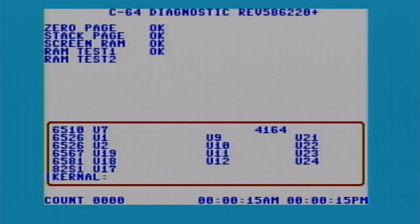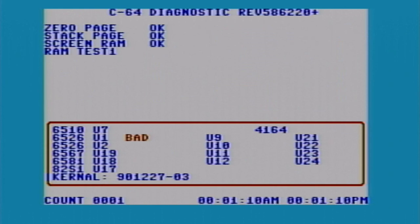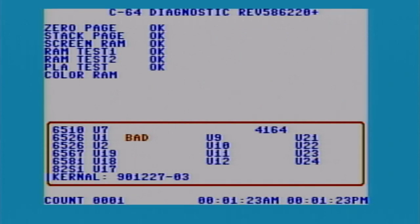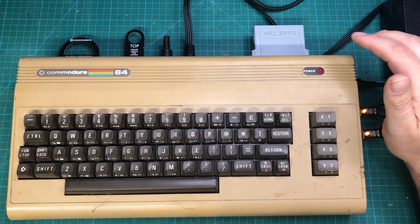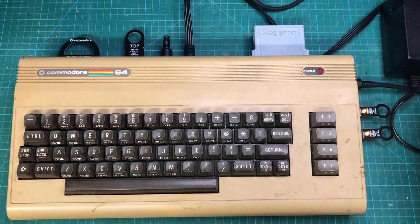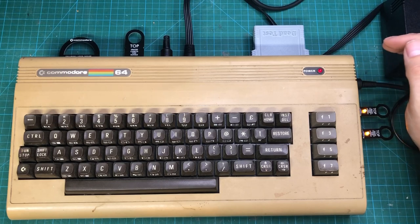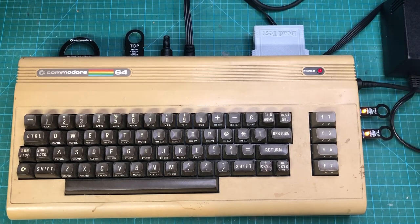This is very interesting — what it's telling me is that the control port is bad and the 6526 chip in U1 is bad. That is the control chip for the controller port, so that chip is probably bad, which is causing the port to report bad. Those chips aren't cheap — they run about $30 to $35 a piece. I had no idea; I bought this thing and this is the first time really playing around with it. As you can see it's looping through the test over and over, but because I have these dongles and this equipment I can get real information. I'm going to look into what it's going to take to fix this. Thanks for watching, thanks to PCBway for sponsoring, and thanks to the legend C64 Istanbul for designing all this stuff and making it available.